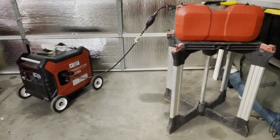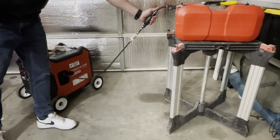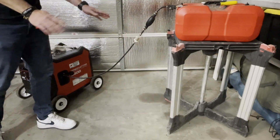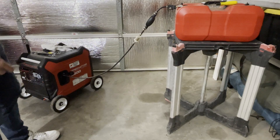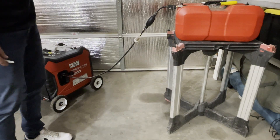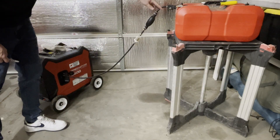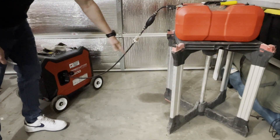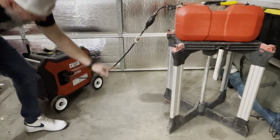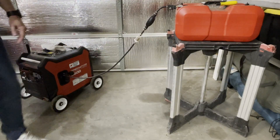The last thing to do is configure your hose. It comes with the bulb, a fuel filter, and about 10 feet of line — plenty for most applications. Decide where you want to put the tank, then cut the line so it has a nice gravity feed going in. Try not to get a big loop — make it nice and level and then up to your tank.